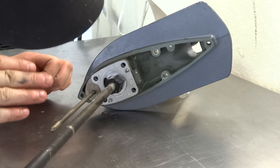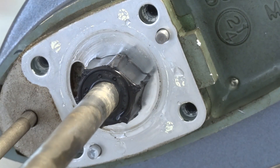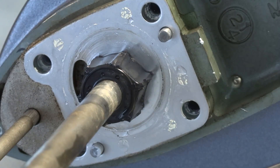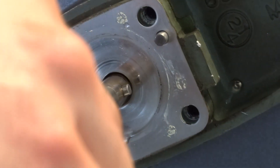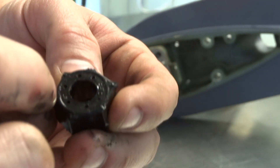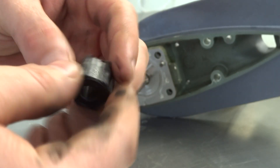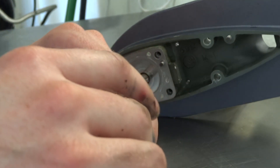The key is to remember which way the impeller went. The impeller just comes straight up — it has a locking tooth right here. This impeller is pretty smart: the top doesn't have the groove but the bottom does, so that means the bottom groove goes down. You don't have to figure out which way the impeller went. If it had a top groove, you could flip it upside down and the blades would go the opposite way — so this is a very smart design.